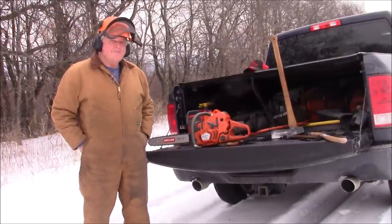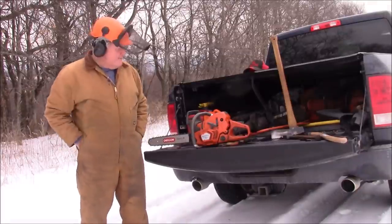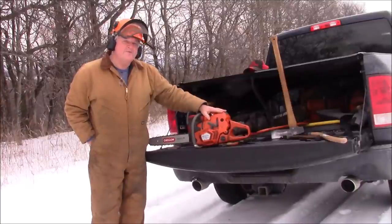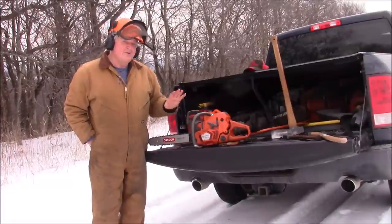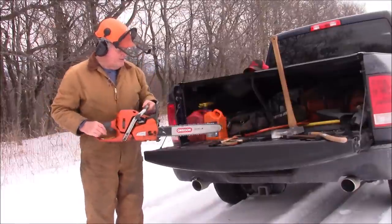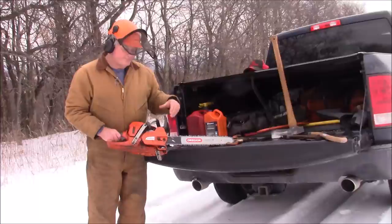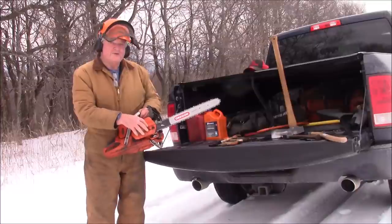It's better to go either find a 560 Husqvarna or an old 2260 Jonsered and build it from there, versus trying to do what I did. A very, very quick review on this series of saw: I did a video a few years back and I said there was five versions. There's actually six, I was wrong. There's four models that are small mount cases. What I mean by small mount, they take the narrow tail bar from Husqvarna and usually they'll run, I guess you can get that bar both in 3/8 and .325, but it's a smaller set of cases.